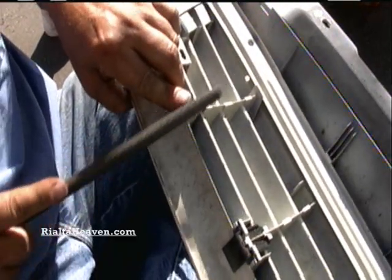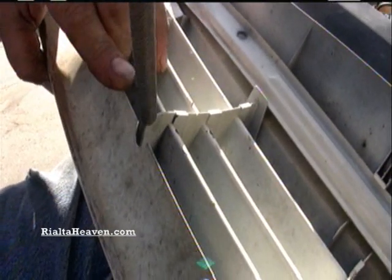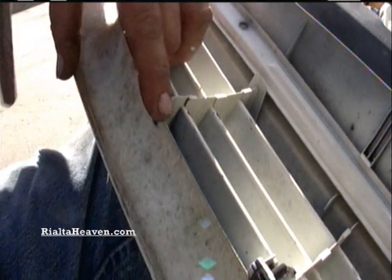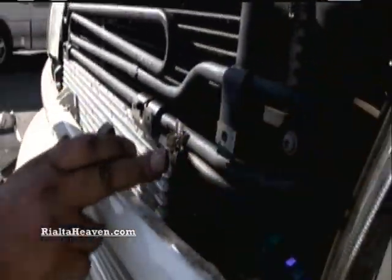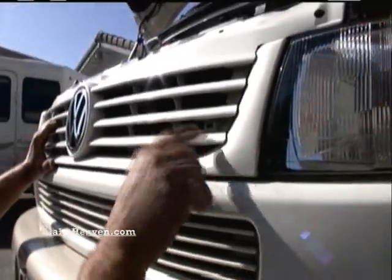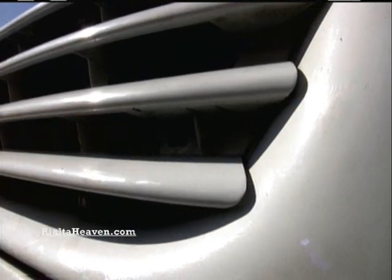It's a little easier if you get some angle on it — just take off little pieces at a time. I could tell from the spacing behind this to the mounting hole up there, this is going to need a pretty deep notch, so I went ahead and cut it a little deeper than I might on some of them. Just try to get the loose flakes and the worst of the sharp edges off so you don't knock any extra holes in your finger. This is what we're making space for — the upper clamp on there tries to run into this thing because of where it's positioned. We don't want the grill to stick out right there; we're going to be able to mount it in the holes it needs to go in. It's not exactly centered, not exactly perfect, but it's clear, and it's all the way against the support in the back, so it's going in as far as it ever did.